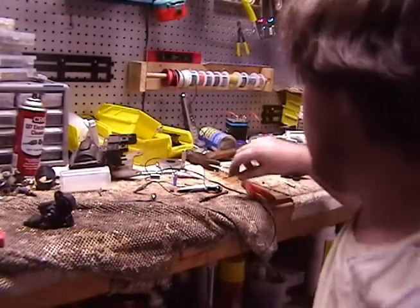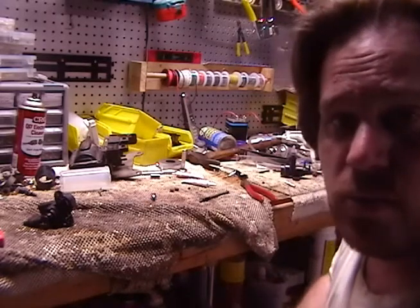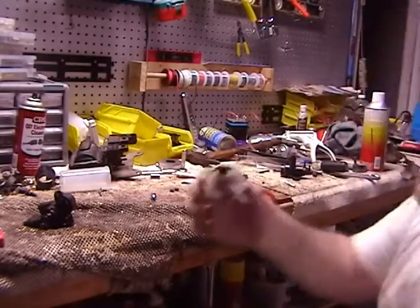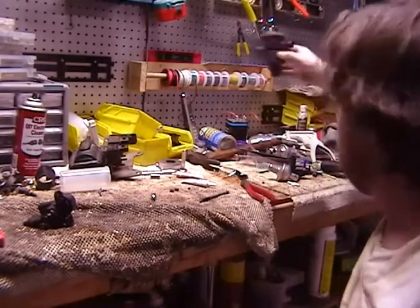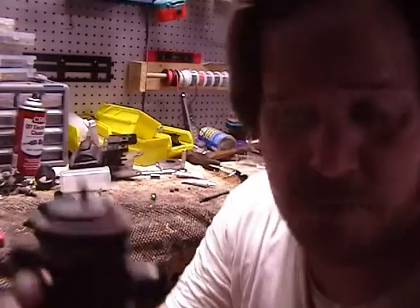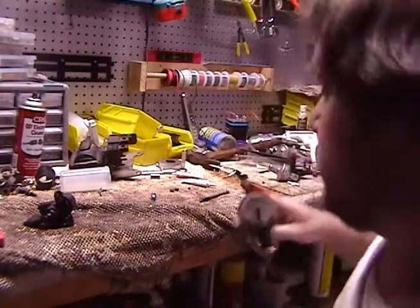As of right now all of our smog is working properly. I've checked all the check valves - here's a check valve. We've got two - this one goes to the smog pump, this one is a little further down, this is the diverter, and this is the bypass. So these are two vacuum valves that can be out like the EGR is - let's test these real quick.